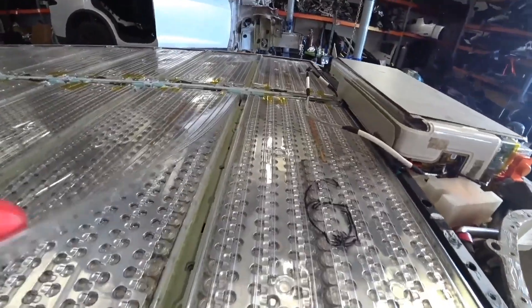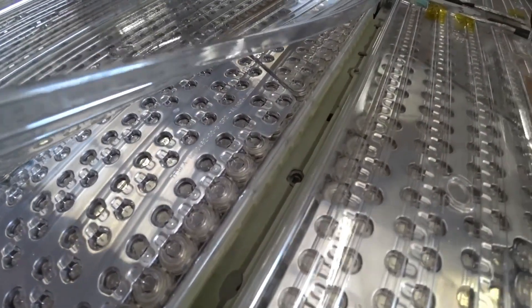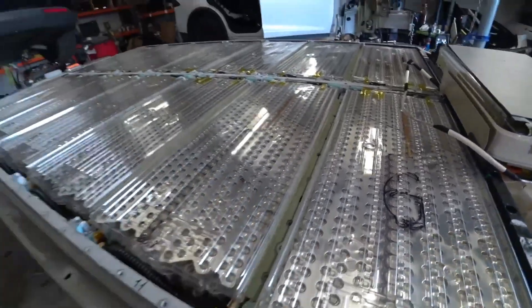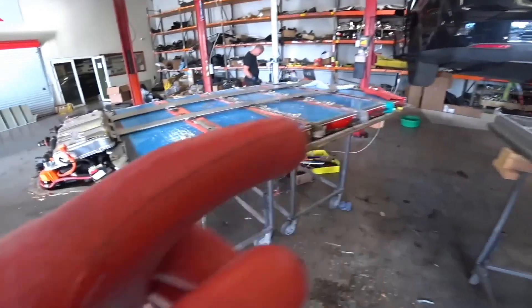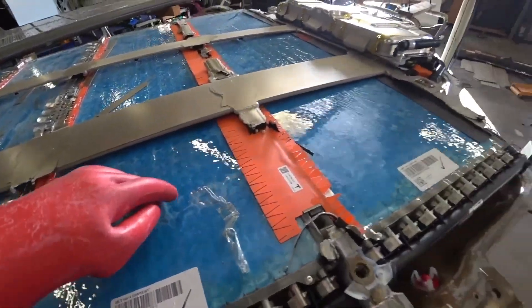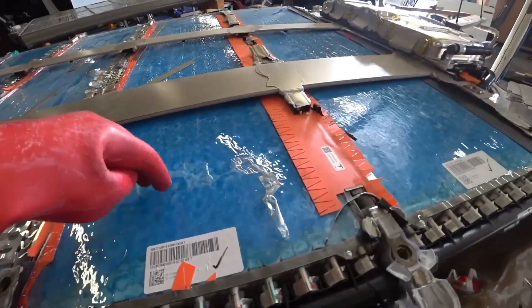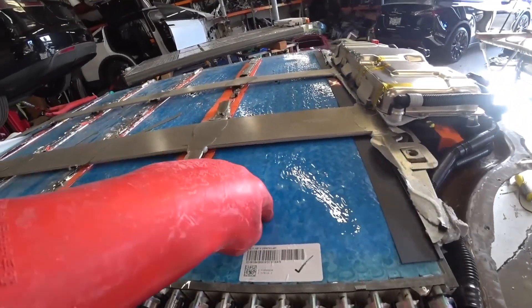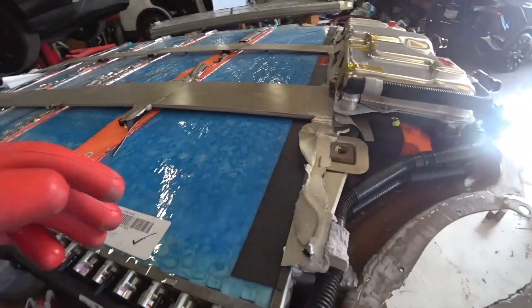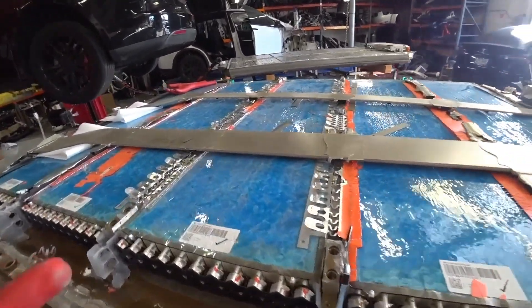Let's start with the old battery. Here are the neat and compact little batteries. They have a bit of a coating on them due to the passage of time. This battery is here exposed — it has no additional fire protection at all, as you can see. This particular newer battery is completely and securely sealed, not because we want it to look fresher or more beautiful, or because blue is the creator's favorite color, but because this fire suppression system — if something short circuits — should foam up and provide additional protection against the entire battery catching fire. It is sealed, reducing the chance of moisture getting in to the contacts, and decreasing the possibility of damaging the battery.